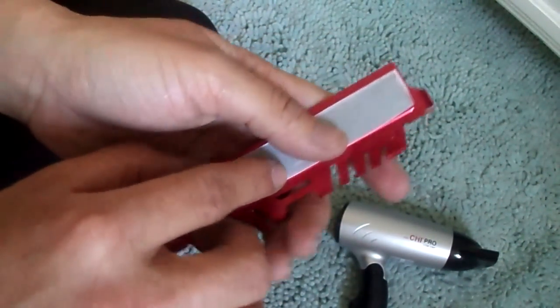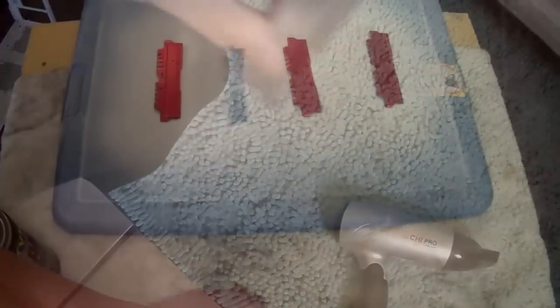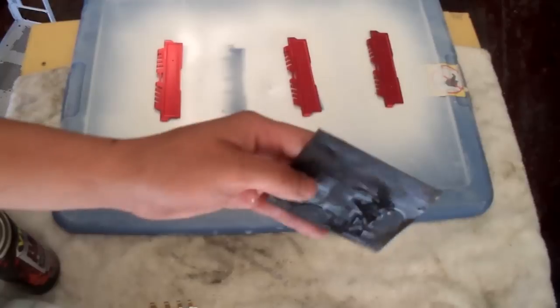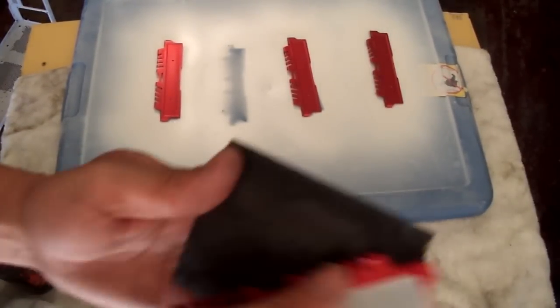I will be reusing the little double-sided tape that they have on there. I took some cutouts — basically a piece of plastic from the boxes my SSDs came in, those little annoying plastic boxes you have to cut with scissors — and cut out a piece to put over the contacts. Now we're going to do some light sanding using 800 grit sandpaper. I'd suggest anything from 600 to 1000.